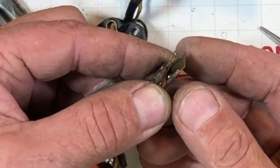Get down here and pick up these axle bushings. Little taste there, little taste there. This is a live axle. It turns. So we have to put just a little oil here and here on this trailing truck. Here's how I clean these wheels. Set this low. You come in at an angle.